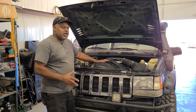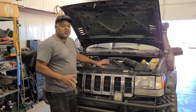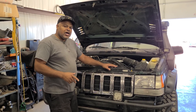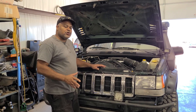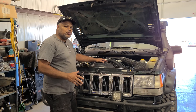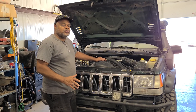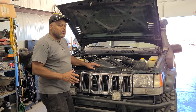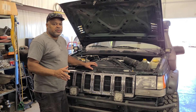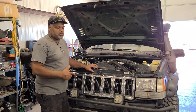That's the basic system for any car, whether it's an old one like this or a new car. Some newer cars with twin turbos might have two cooling systems — a high temperature and a low temperature. The low-temperature system is for the turbos and intercooler since they run very hot. That's why there are so many hoses, fans, and components on those cars. A lot of people will say they took their thermostat out and it runs great — initially it might run cooler, but you're going to have overheating issues when the system is stressed with no thermostat in it.